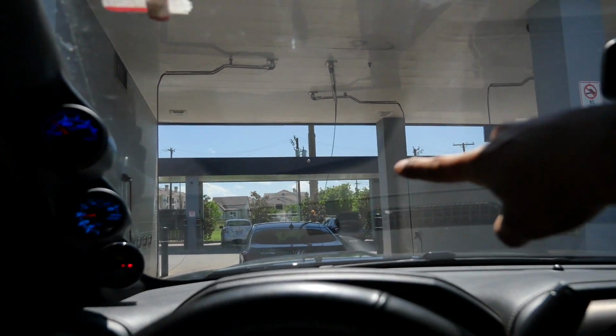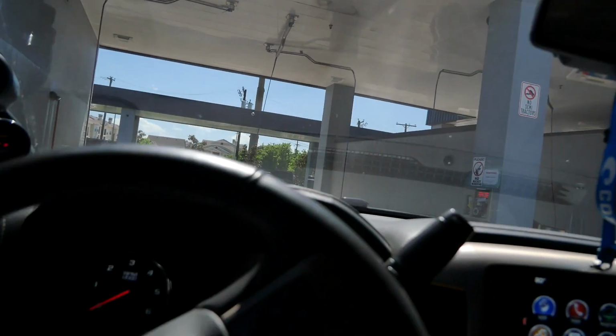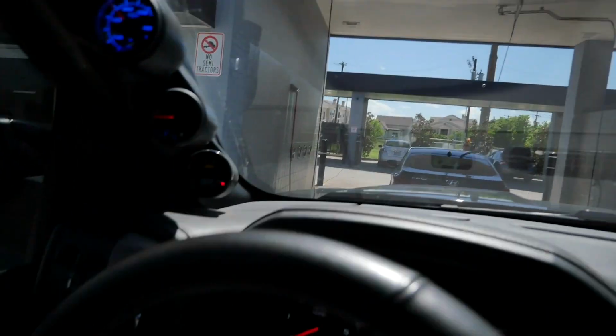All right, we are at the car wash right now. We're waiting for this lady to get done washing her Hyundai Elantra. I guess just an update on the truck while I'm sitting here so I can talk to you guys about it. It's on a base tune right now. I have to fix the O2 sensors because I think they burned up when I was driving it. It had no tune, or somewhat of a tune, and it ran really rich. So I gotta get two new O2 sensors for it, probably in the next video, I don't know which video it's gonna be.